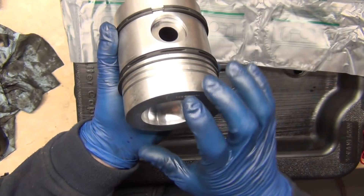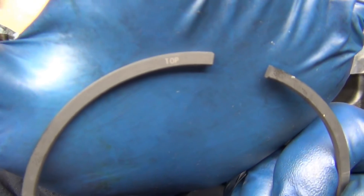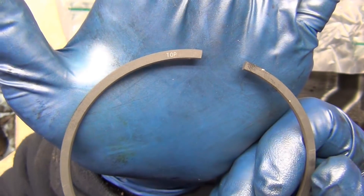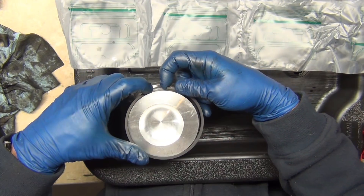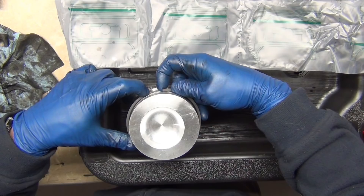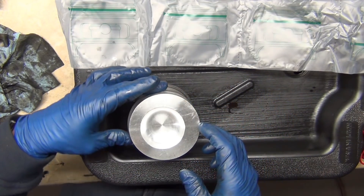What I do is split the gaps like a BMW or Mercedes symbol — then move the others around the other side so they're all kind of separated and you don't get gases going straight down. Again, it says 'top.' If you're getting the Maxi Force kit, buy it from the guy out of Arizona on eBay — he gave me really great service, fast shipping, everything was rainbows and sunshine.